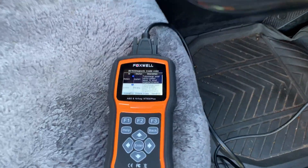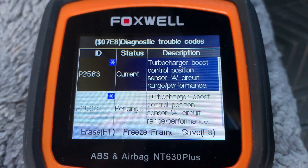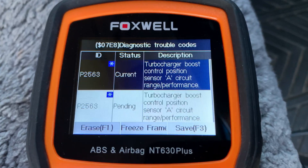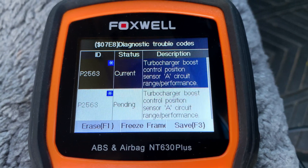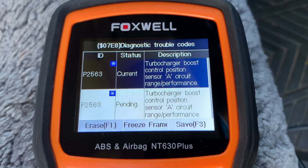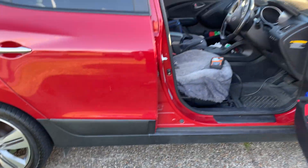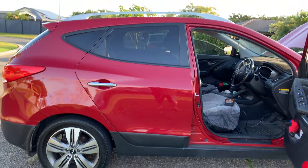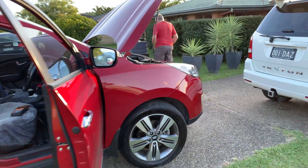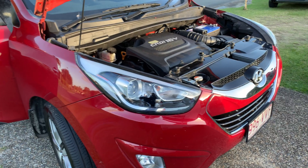This was originally a Peugeot based engine and it comes out in different sizes — 1.6, 1.7, 2.0 litre, and there's a 2.5 litre in this engine range. They all use the same turbo boost pressure sensor, which is called a MAP sensor — M-A-P, Manifold Absolute Pressure sensor. Looking at the amount sold on eBay, there's been hundreds if not thousands of these parts sold because they quite often go. So we're going to swap this part out and hopefully reset the codes, turn the engine light off, and that will be the end of it.